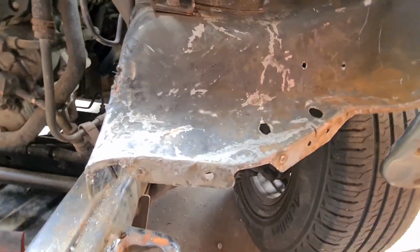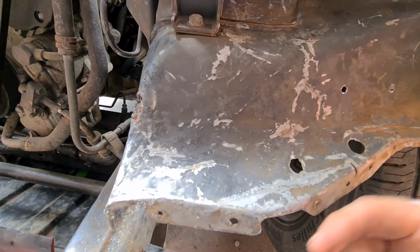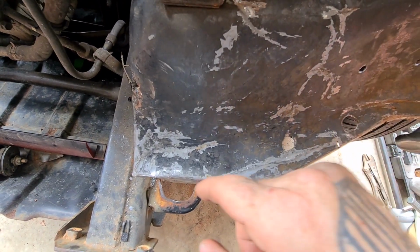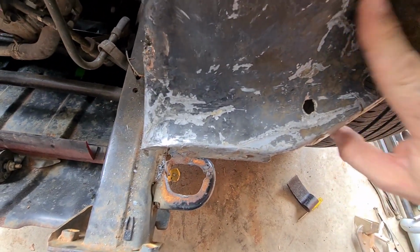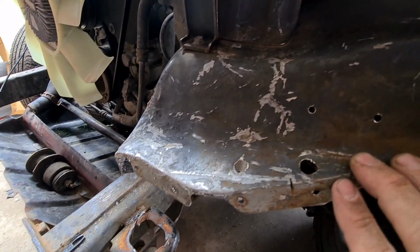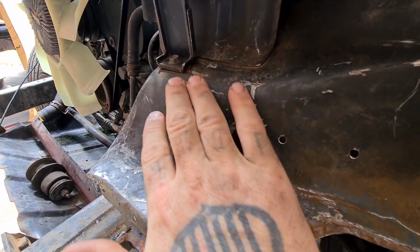So if you remember, we had a 90-degree fold there. So we brought this shape back out and into it, so it lines back up in the firewall. So that's fairly smooth. I mean, this isn't planished or anything, guys, so it's not perfect. I can get it probably better than this. But this is about half an hour of playing with it or so.